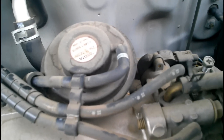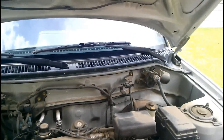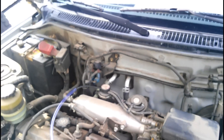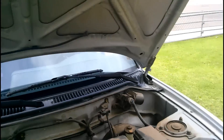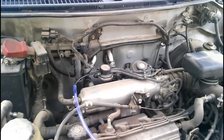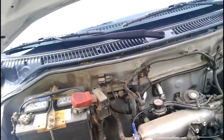These test results mean: if applying a vacuum to the EGR valve did not cause your engine to struggle out or die, it means that the exhaust gases are not adequately being sent into the intake. This could mean you have carbon built up along the exhaust passageway, or your actual EGR valve could be at fault. If doing the test on the Q port you saw no vacuum, it would mean that the diaphragm inside your modulator has a tear in it and is bad. If your test results were like mine and all your hoses check out, then that would mean that your vacuum switching valve is at fault.